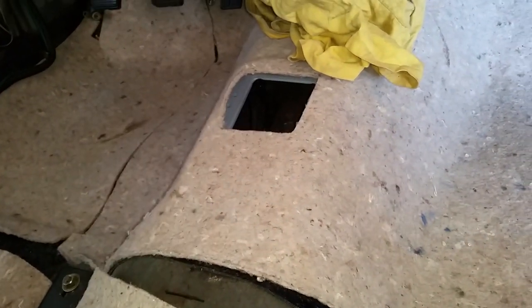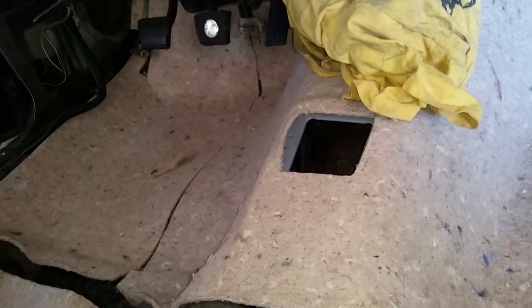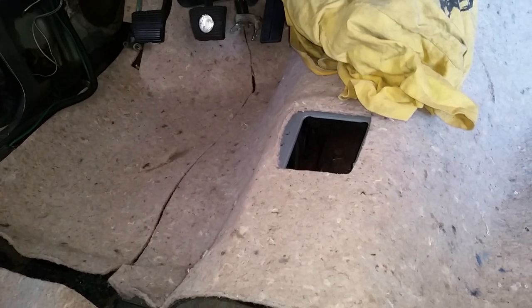I just added a few pieces around the shift hump on each side and on the very top. I used 3M 77 on the back of the sound deadener to keep it in place on the floor pans, and then I used 77 on the back of the jute and laid it down to contour the floor pan. It's working pretty good — I think the carpet will go in a lot better.